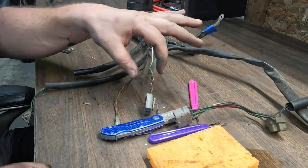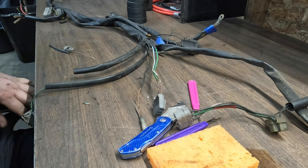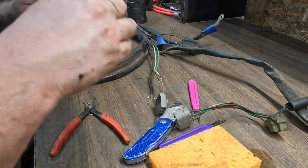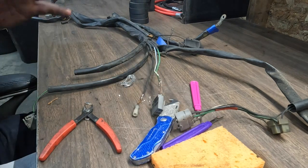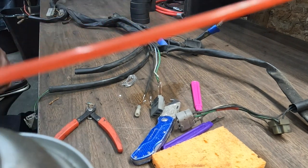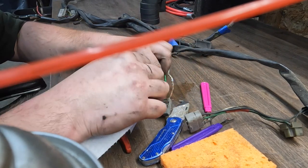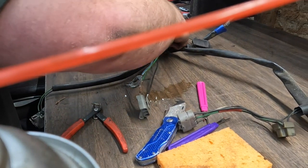You need to let that cool down before you slide your heat shrink back up. To finish that up, you just want to take some brake cleaner or acetone to clean up all the remaining flux. Speaking of heat shrink, this is specific marine heat shrink which has a sealant layer on the inside. So when you get it hot, that'll melt and seal it nice and tight around your insulation, keeping moisture out and preventing that from happening in the future.